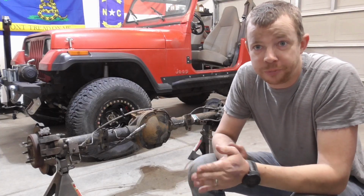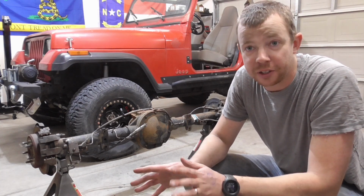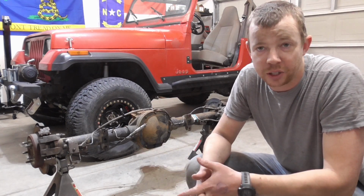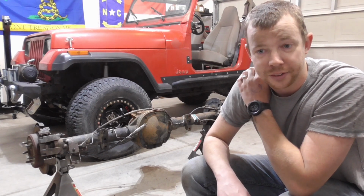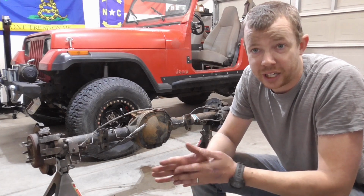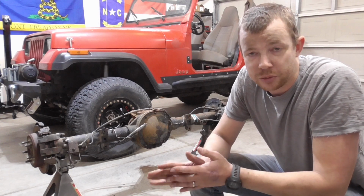I got my rear axle. So it is the 355, like I said, and it is open. I checked the gears before I started pulling it when I was at the junkyard, and the ring and pinion look brand new. The spider gears look fine too, but that's not really that important since I'll be replacing them with the Spartan locker. So I'm whooped for today, but I got a good start for tomorrow, next weekend, whenever I want to get started back on it.